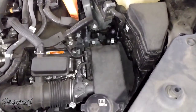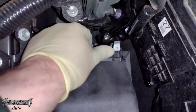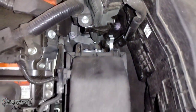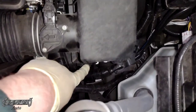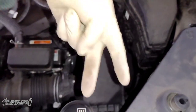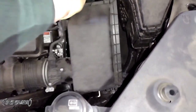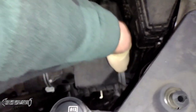Pop the hood and come over here. There are little spring clips — just take your thumb and push them off. There are little tabs in here; lift this up gently and pull towards the back to get those tabs out. You don't want to break those tabs.